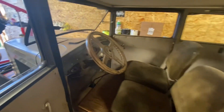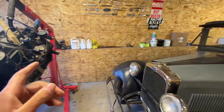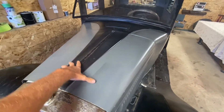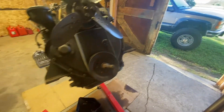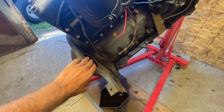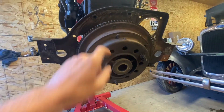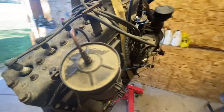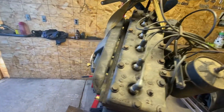I've actually already started tearing it apart — I pulled the motor out of this car already because I couldn't get it to run. I was gonna do a video on it but it was basically just me hooking that to that and pulling it off. Pretty simple. The hood and everything just comes off — there's like one bolt that runs here, the rad has two bolts and comes off. The engine itself was the easiest I've ever done — a bolt here, bolt here. I thought I could leave the plate behind but the clutch was too rusted on, so I just undid those bolts and it came right out. If anybody wants to buy this motor, it's supposed to be all redone. You can tell the gaskets and bolts have all been touched.